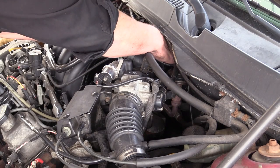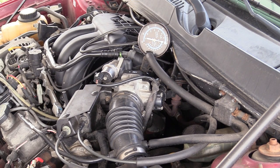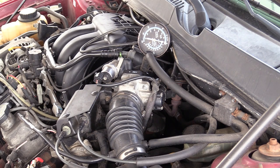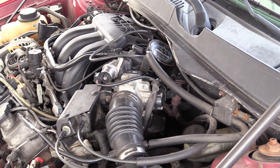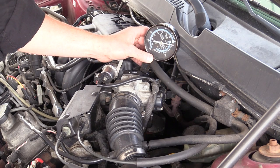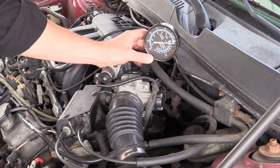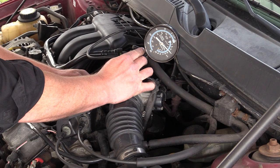The fact that that sensor is blown apart tells us what we need to know too. The test I use for these - that has not failed me in 20-some years - is no more than two PSI at 3000 RPM. I'll bet it's more than that even at idle. We're like one and a half just sitting here at idle... four PSI.